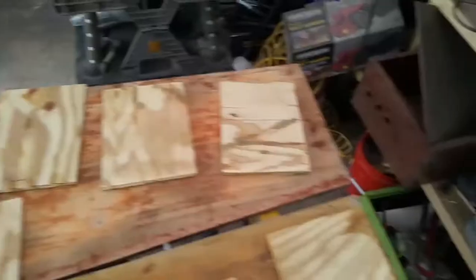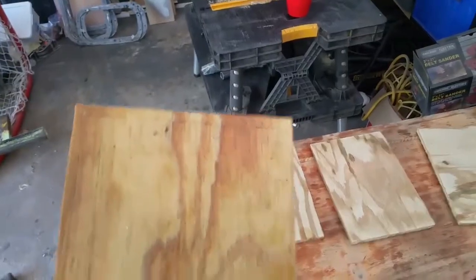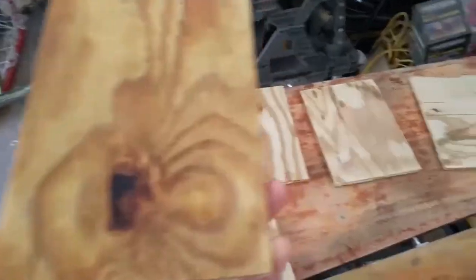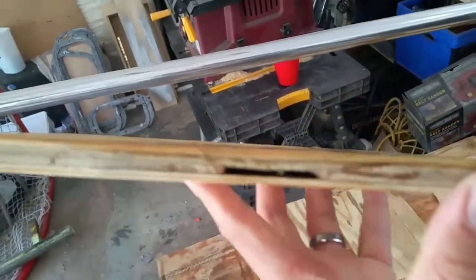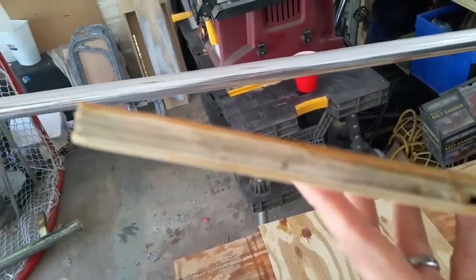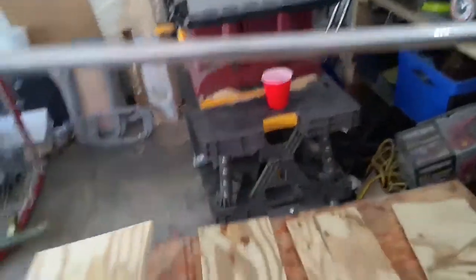What I want to show you are my backing plates. Typical plywood — three-quarters of an inch, or half an inch. I did one side with thinned epoxy because we want it to seep into the wood. That top layer is a little bit darker than the middle. It does a couple of things: first it seals the wood, secondly it strengthens it. These are going to be behind load-bearing deck hardware.